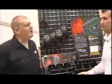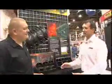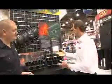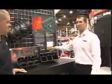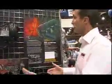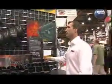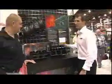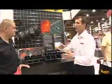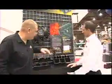Did I even ask you power numbers? I've been so impressed with the design and the look of it. I don't think we even covered that. No, look, back to back on, say, a 5.7 GTO, we found, as you see here on the graph, 32 more horsepower gain over the LS6 manifold, which is a good one. But the beautiful thing, we made a peak of over 31 foot-pounds more at 4,000 RPM. Nice and low. Not only did we make more power and torque, we've brought it down earlier and held on to it later. Yeah, and there's a big area under that curve of additional power.